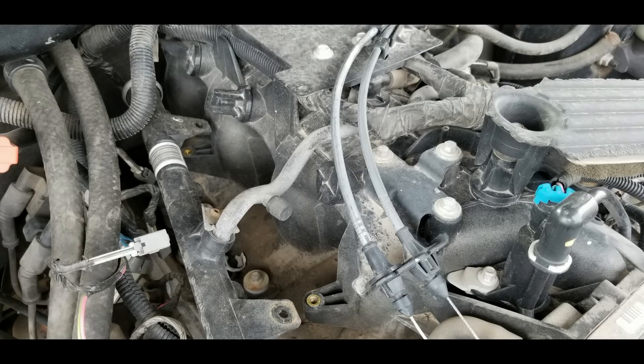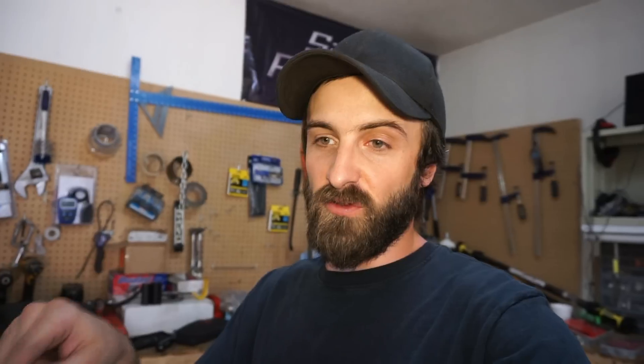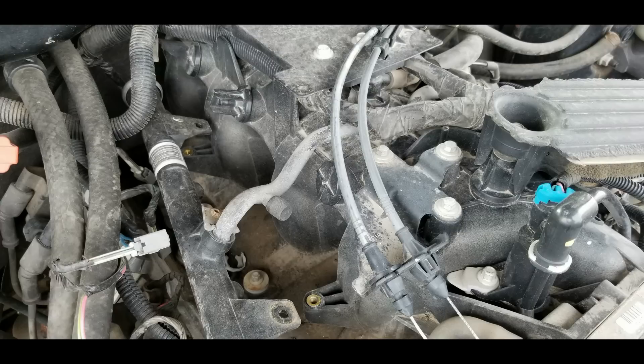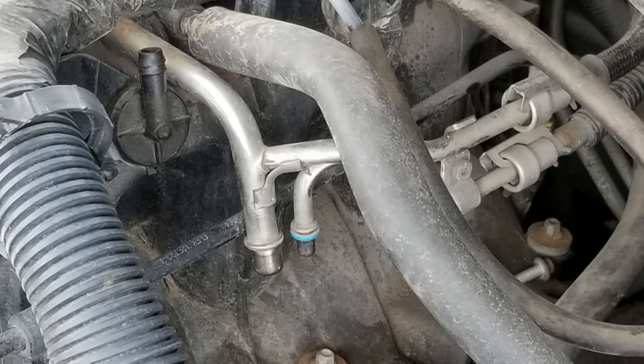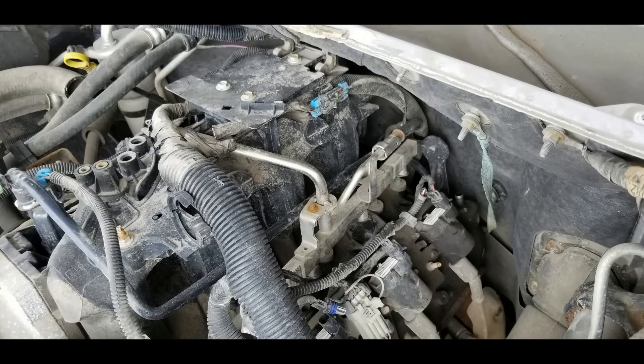That's an easy visual check at the junkyard — look at the VIN 8th digit. If it's a Z, it's the L59 flex fuel engine, because a lot of vehicles at the junkyard are ripped apart, some don't have fuel rails on them, some are missing the gas cap sticker. The flex fuel vehicles also have a different style rail — almost like an aluminum rail versus the standard steel rail that gets all rusty. The non-flex fuel one has plastic rails with a steel crossover that corrodes; the flex fuel one looks shinier and is in better condition because it's a different material. The 2006 Suburban I saw did have the actual square flex fuel rails on it.